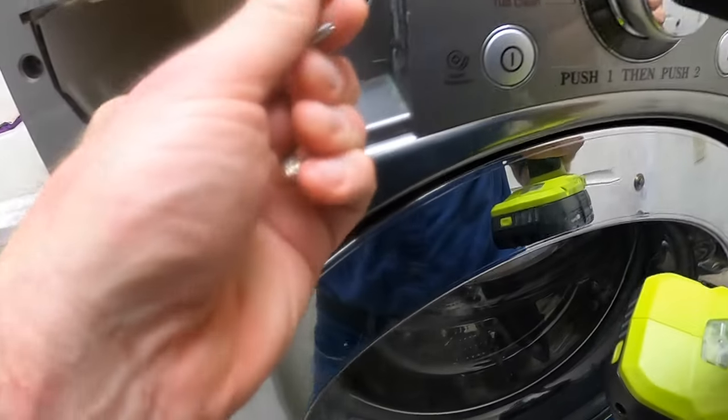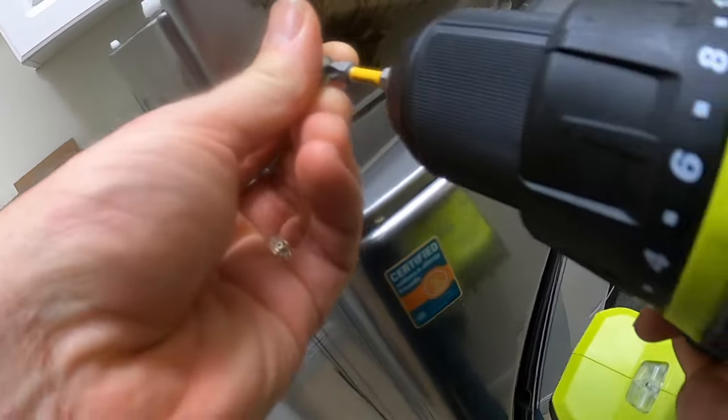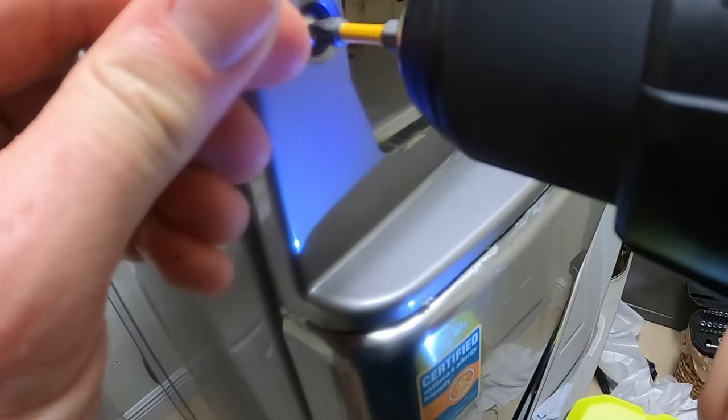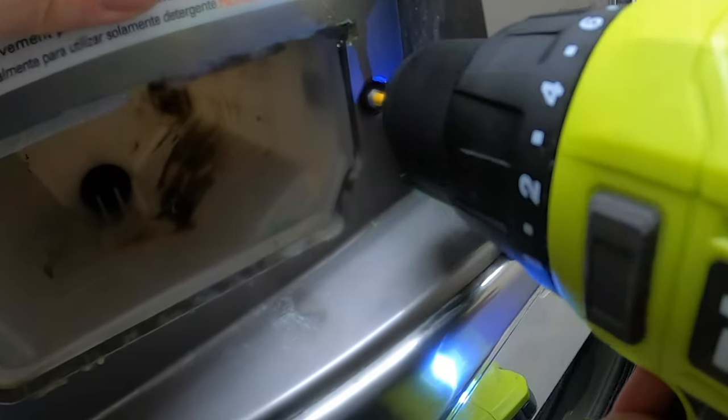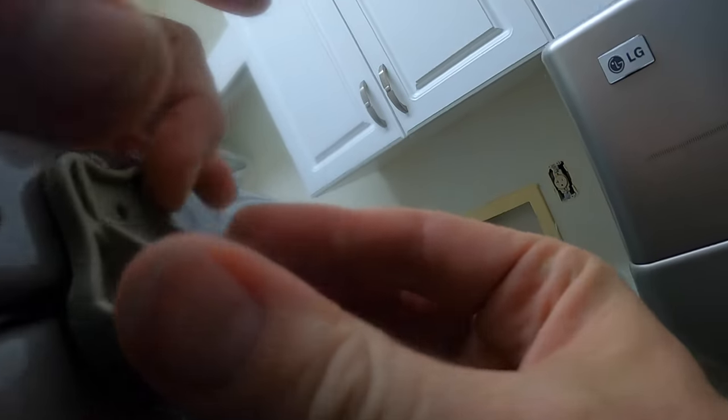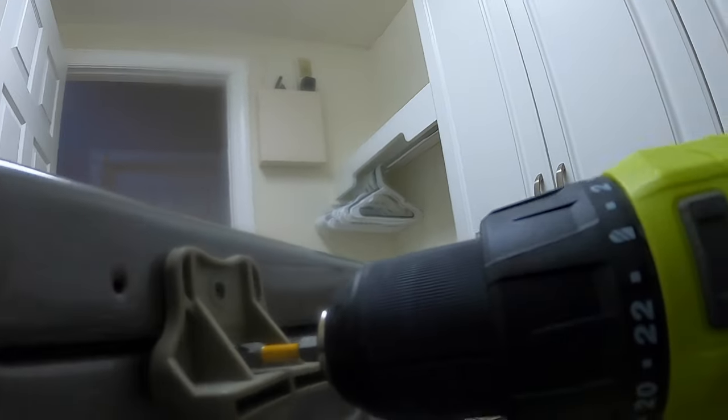There are three screws securing the user interface to the body of the machine. Two here in the front, and one in the upper left corner on the back. Put the lid back on top and slide it forward into place. Put the two gray plastic clips back in place. Then drive the four remaining screws home.